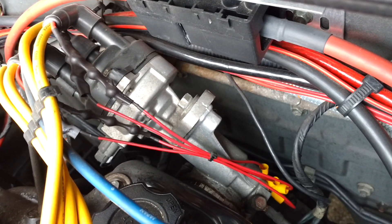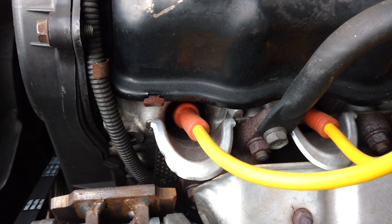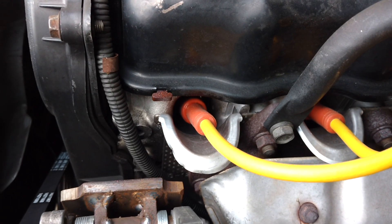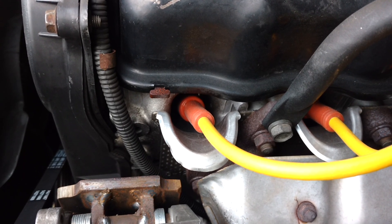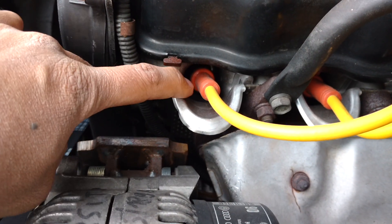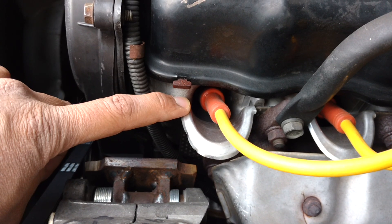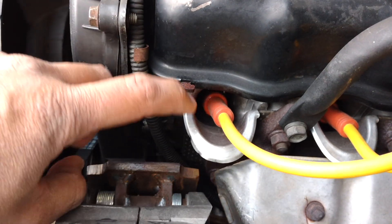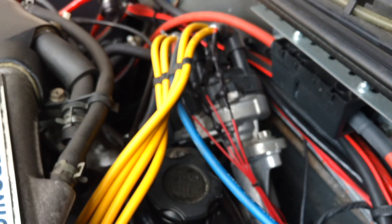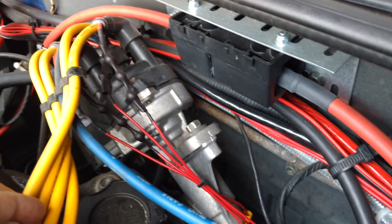The reason I put the setup like this is because I don't have any space in there. I tried to install the capacitor directly on the spark plug, but I have so many leaks here — so instead of having a spark in the combustion chamber, I was getting sparks outside. So I just put my capacitor over there.